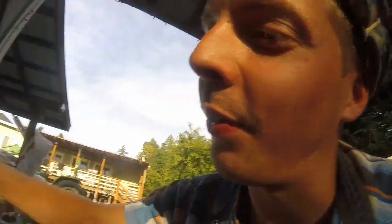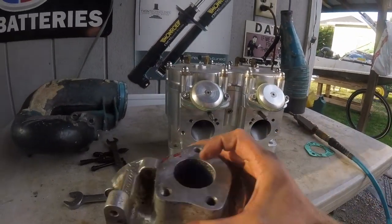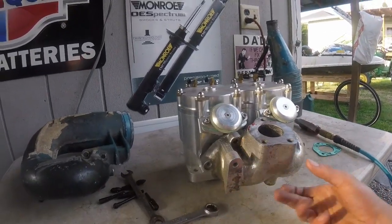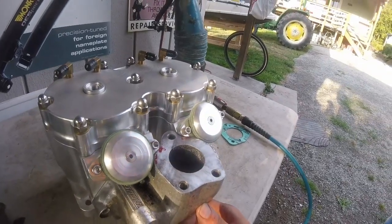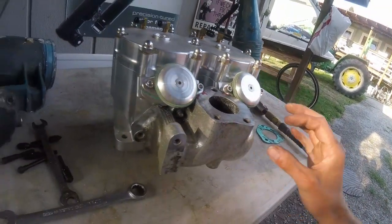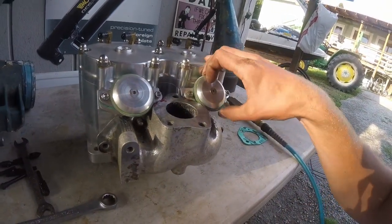But yeah, whenever you're doing something like this on a DASA, you're gonna have to be thinking about these exhaust power valves opening up, right? And so when you stick a regular exhaust in there, there's going to be all sorts of metal in the way. It's not going to want to go up all the way. So you can check it out. I've really had to hog stuff out to be able to get it to have clearance. And right now it's butted up all the way after a lot of work. And these guys open up.